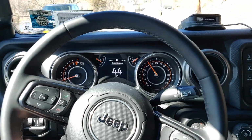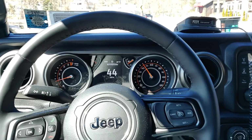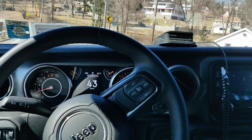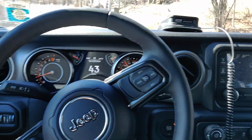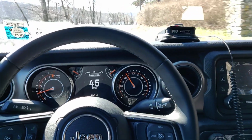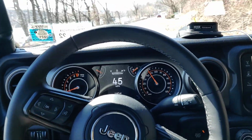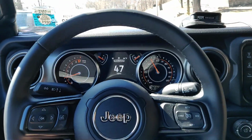And then I figured, let me just see what's out there on YouTube. A lot of people complain about the same thing, and some of the comments in the threads were to just air down the tires to 35, 36, and you'll see an improvement. I did. The steering dampener improved it a bit more, and I think I'm happy with it now. I mean, it's still not as good as a stock JK for reasons that I just don't get. Why, with a newer iteration of a vehicle, the steering, for some reason, has gone backwards.